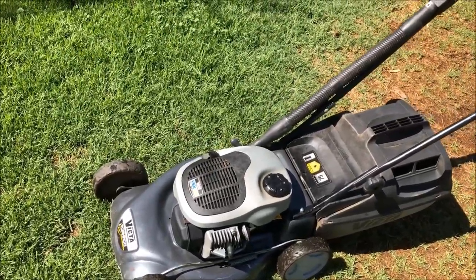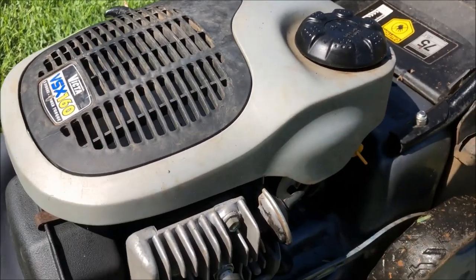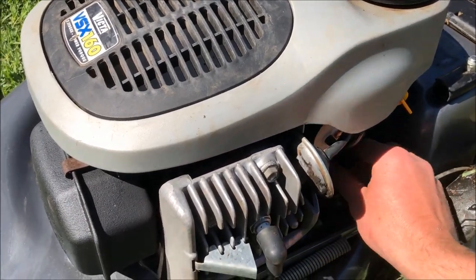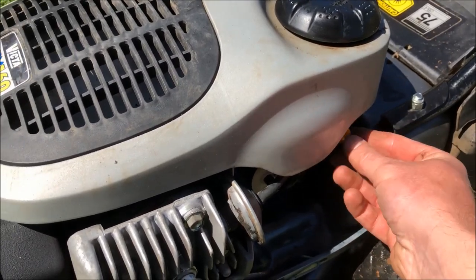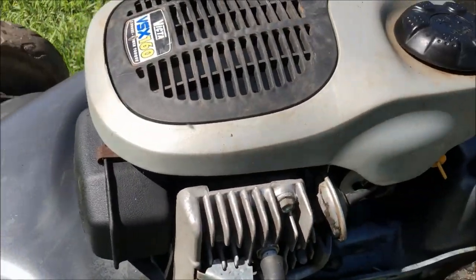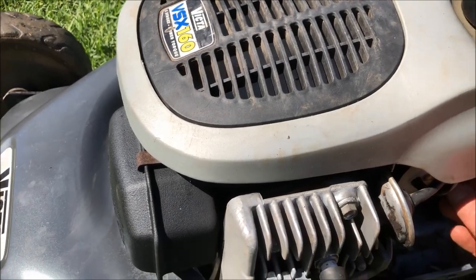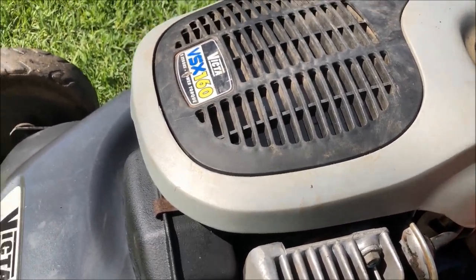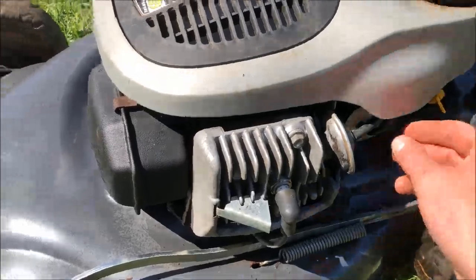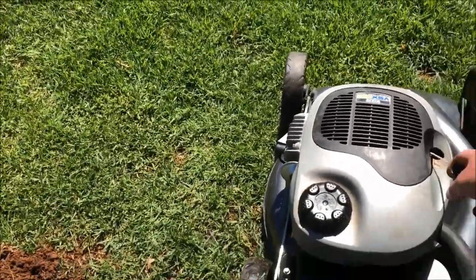We're all back together now. Exhaust is on - looks a lot nicer than the rusty colour. Turn this fuel on - probably won't start straight up. Sometimes when you've had the float cover off it does take a couple of goes. Might need to replace this fuel tap, I'm not entirely happy with it. Other than that, a quick polish and a clean up, and we should be able to put it up for sale this weekend. We've had about two inches of rain in the last two days so that'll help matters too.